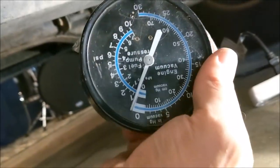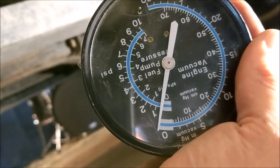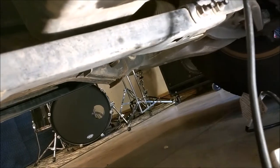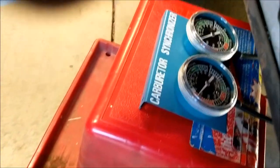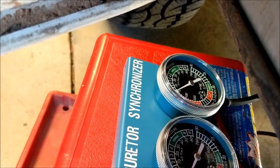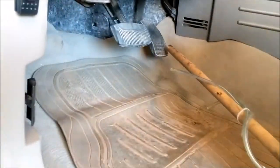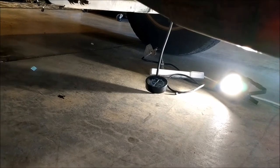I've got the truck at idle. As it idles down at low idle, it's well under 1 PSI on this vacuum gauge — though you can see wobble in the needle because this one doesn't have a snubber. I've got the gauge set up so I can see it while I operate the pedal. I'm going to raise the engine speed up. That was over 3,000 RPM, and checking the tach, it was still sitting at 1.5 PSI. Back pressure's good.